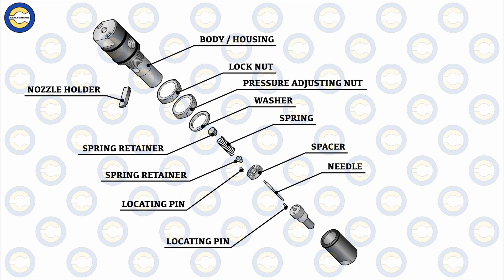The needle is the part that lifts to allow fuel injection into the combustion chamber. The nozzle is the precision component through which the fuel passes upon lifting of the needle and gets atomized into very fine particles or a fine mist through the fine holes of the nozzle, making it practical for these particles to combust within the combustion chamber. The cap nut is the bottom part that seals the assembly from the bottom and keeps the nozzle secured in place.